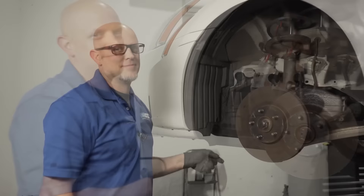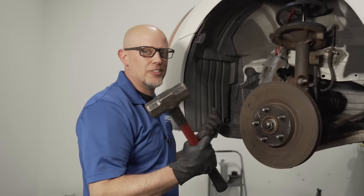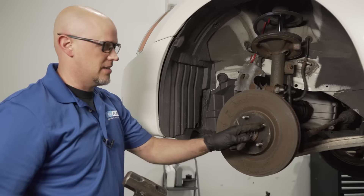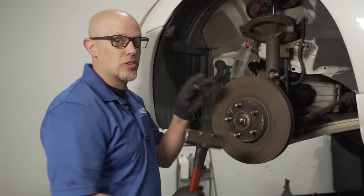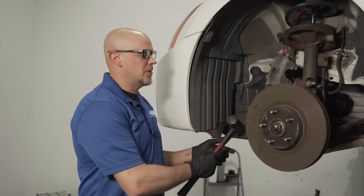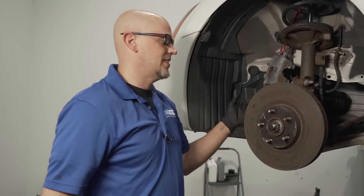Now let's talk about the rotor. When taking the rotor off, if you can just grab it and slide it off, that's great. If not, you can use a hammer and tap on the rotor in those locations — just be careful not to hit the studs. Normally you don't want to hit the rotor itself in case you need to reuse it. If you're having trouble, spray some rust penetrant in the holes and let it soak. You can also tap from the backside, but make sure you get it off cleanly, or you're going to have marks in the rotor.